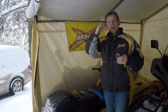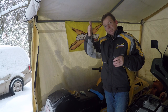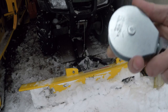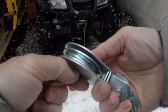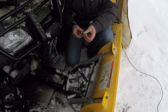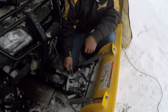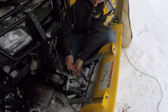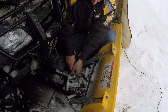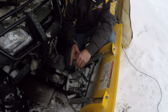The other thing I got was a shackle, because I also wanted to reduce the angle that the cable goes down. If I get the pulley up a little bit higher it's going to reduce that angle. I'll start by taking the pulley roller out so I can get the cable in — I don't even need any tools for this. I'll put my shackle on there and put it through the hoop where my cable used to attach, then tighten that up.